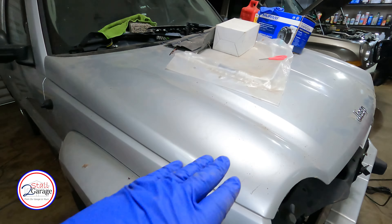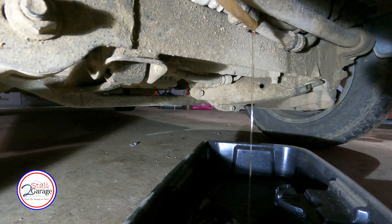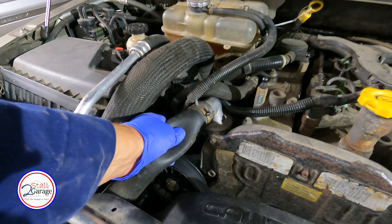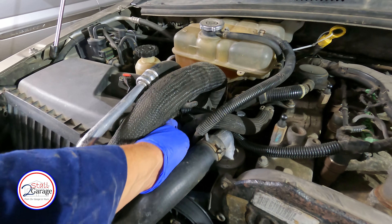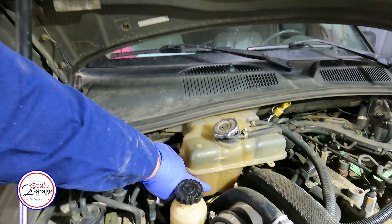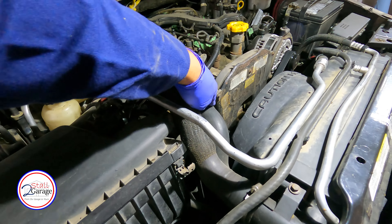Here's our thermostat right here. The engine's still a little warm — I just got done driving it. I'm going to drain out some coolant so there's none left in this hose. When you're going to drain coolant from your Jeep CRD, it's on the passenger side just right up under here — you can grab it and turn it. I think it's about a 14 or 15mm. I've got it draining from that little tube right there. I squeeze this hose to help move fluid through until we've got all the fluid out of the tube and the reservoir.